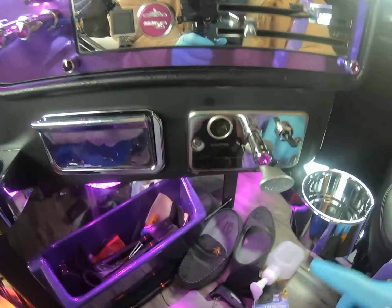So let's say, for example, if you're splitting each gear, the RPM drops 200 RPM. If you don't split them and you're going 2x2, then it's got to drop 400 RPM. Now, I'm not looking at the RPM, but after a while you'll kind of get used to that, and you can hear it. You'll just wait a little bit longer, put it in the next gear and off you go. You're not grinding anything. You're not messing anything up.